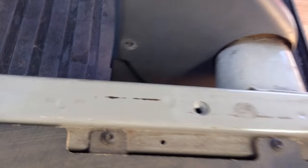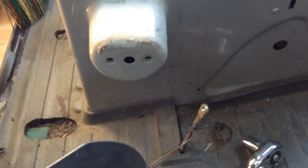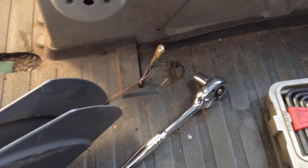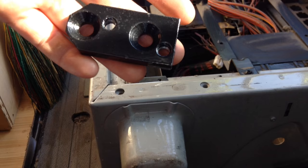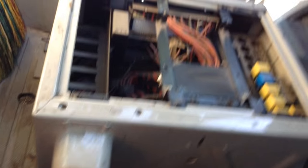Mine was already gone so I didn't need to trim the cover. But if you need to trim the cover, this is how you take it off. You have to remove that pin — just snap it out. There's another pin on the other side as well. So you also have to remove those two bolts. This is what it will look like when you've pulled it off. They include a little spacer that is supposed to go on your emergency brake mount, so now that I've got that off I have to install this onto here and then put everything else back together.